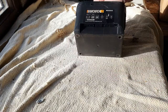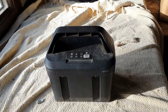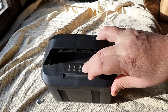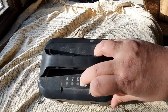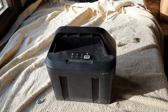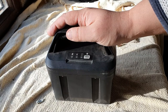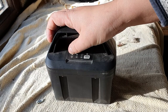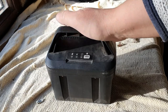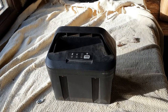This one is quite handy because it's battery powered. You just charge up the battery, chuck it into the mower and away you go. The battery is showing two out of three bars. However, when you charge it the battery pack itself gets very hot, and even if it's showing three bars it powers the mower for about five minutes and then fails. I think the battery pack has seen better days.